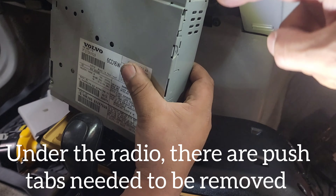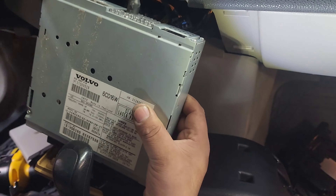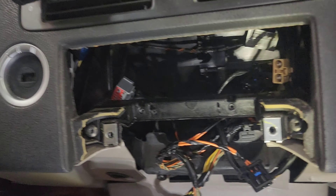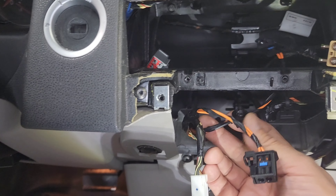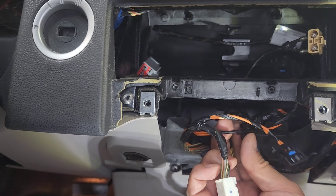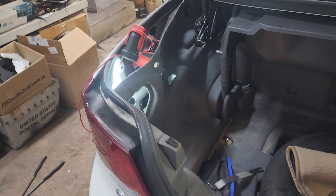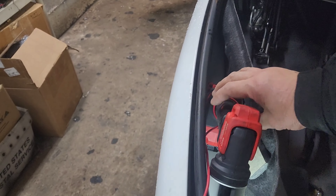There are clips on the bottom of the radio panel — you're going to have to release those; I'll show you where that is. These locking clips are mounted on the bottom of the radio and they hit this frame right here, so you're going to have to undo this little locking pad. That's a fiber optic — be careful not to break it. This unit has an amplifier connected via fiber optic, so obviously we're going to have to disconnect that.